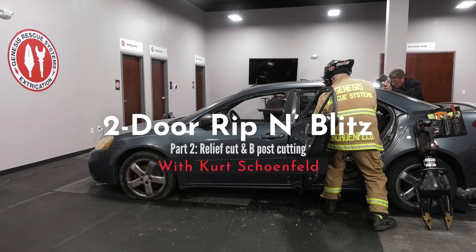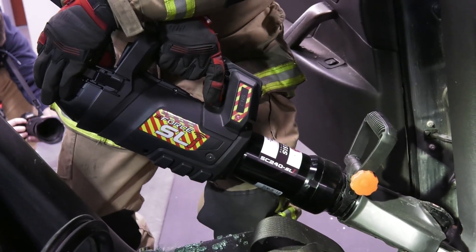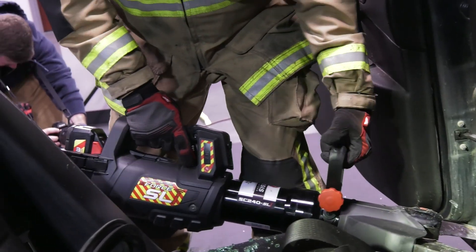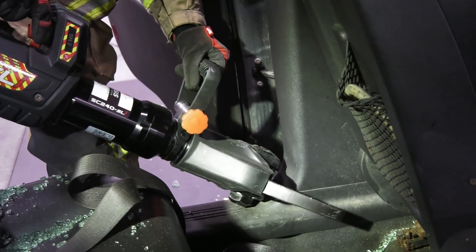You can see I'm going to guide that cutter in with my knee. I'm also paying close attention to the rear of the rescue tool — it's up in what I call the free zone. In other words, it's free of getting jammed up against the car. So again, I'm going to come in at a nice steep angle and guide it in there with my knee.